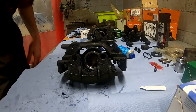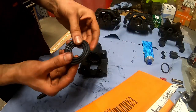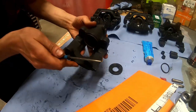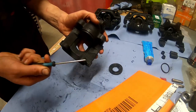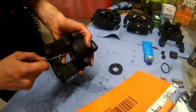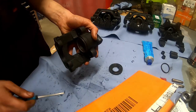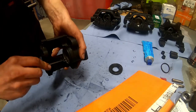For the rear caliper it's basically the same process — just a little bit more difficult because the rubber is a bit stiffer and less flexible, but that's the only issue. One thing I didn't mention on the front: you should really check this groove carefully for any gunk left from sandblasting. Just clean it out and make sure it's gone — I should have done this at the beginning but forgot. Can't be perfect every time.